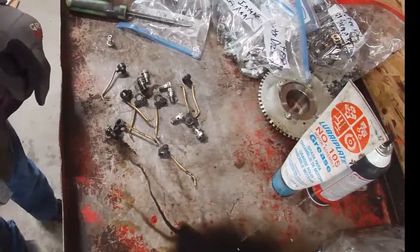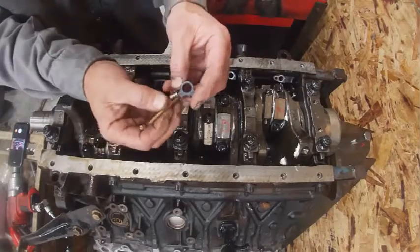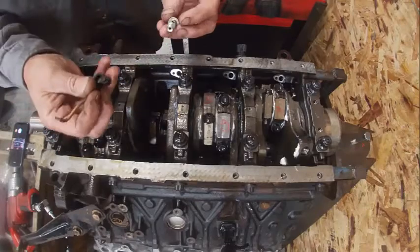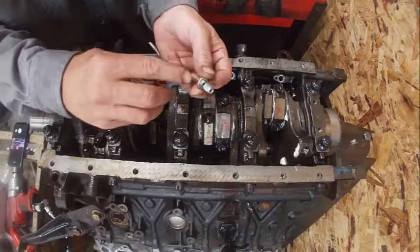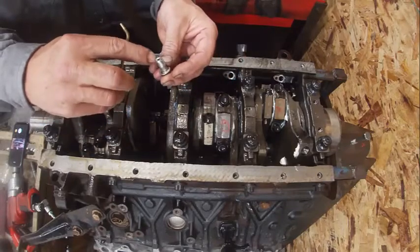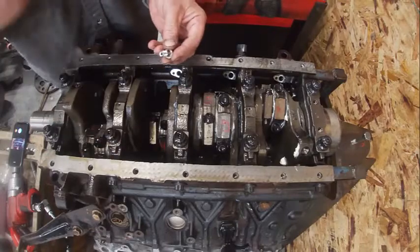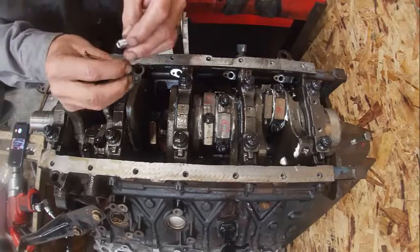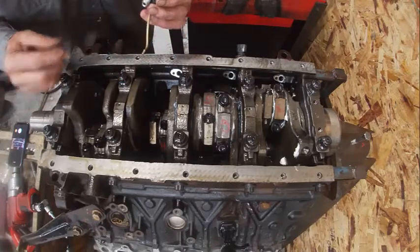Then we'll be ready to put them in. Here's what the oil cooling nozzles look like. This hits directly in the hole from the bottom of the piston. This bolt — oil comes in the center of it. You can see there's a hole there and a hole there. Oil comes up the center; there's kind of a check valve in here. This threads directly into an oil gallery, pushes the oil through into the gallery inside, which sends it up to the cooling nozzle. There are no o-rings or anything like that on it.